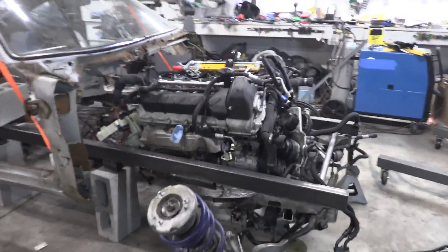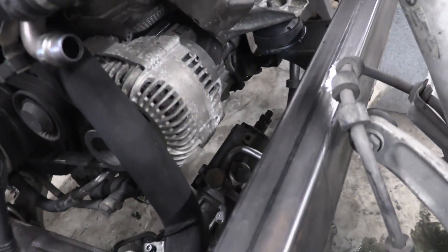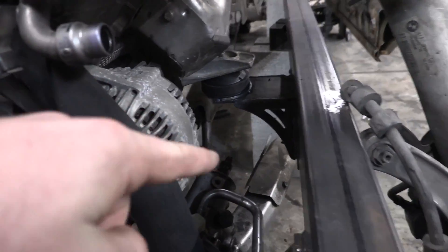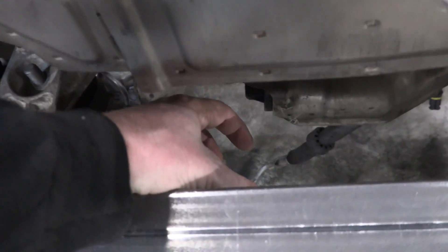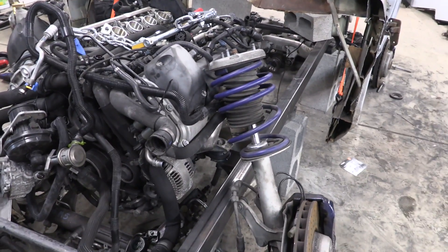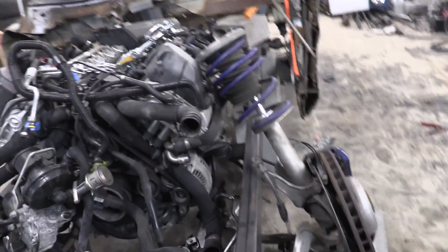This feels like such a freaking victory. I've been wanting to get these things welded up and the engine mounted for a long time, and it's finally done. We've got plenty of clearance between the alternator and the steering rack, and plenty of room to send the steering rod from its point here back towards the firewall. We'll build an extended joint that runs from there down to a mount off the frame rail and then up through the firewall like the OEM car.